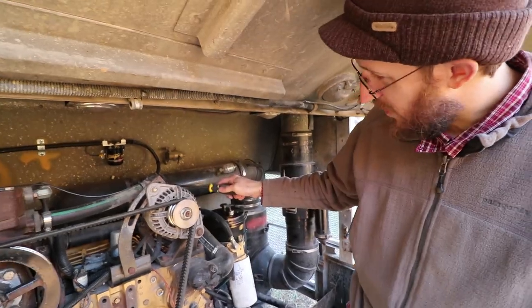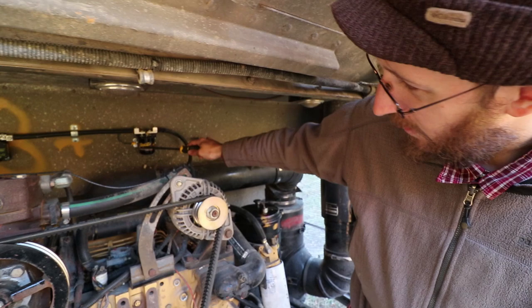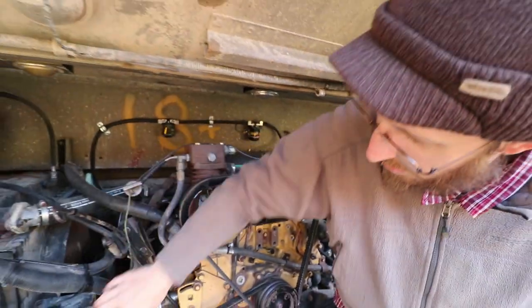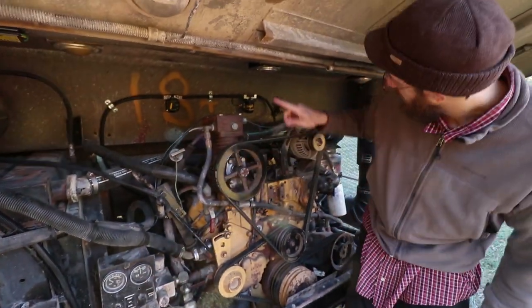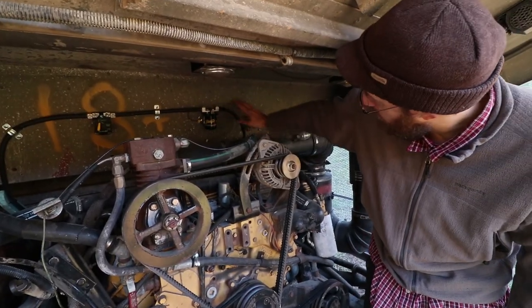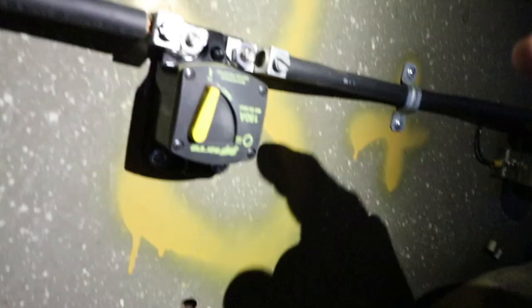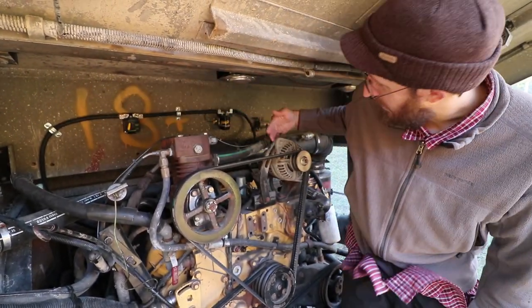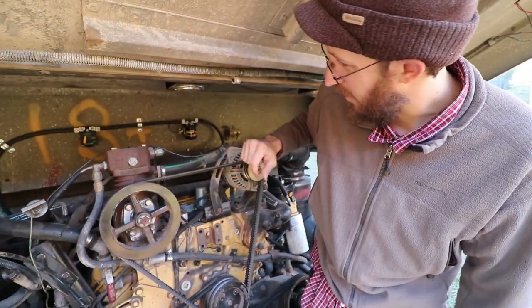Here's your alternator. There's a charging line that comes right off the alternator and goes up through this solenoid. The solenoid is triggered by a little signal wire tied in somewhere here. When you turn your bus on, it sends a signal to this switch, opens it, and sends your alternator charging over to the batteries. It also goes through this breaker, so if the line is severed between your engine and the solar batteries, this will trip and protect both the batteries and the alternator.